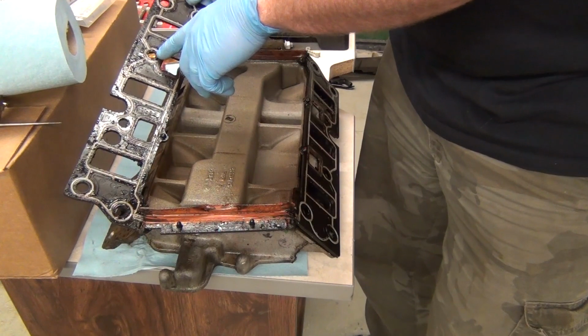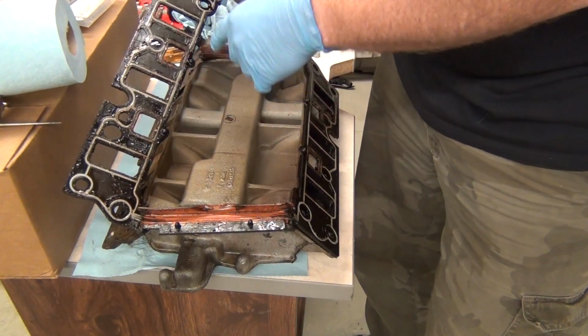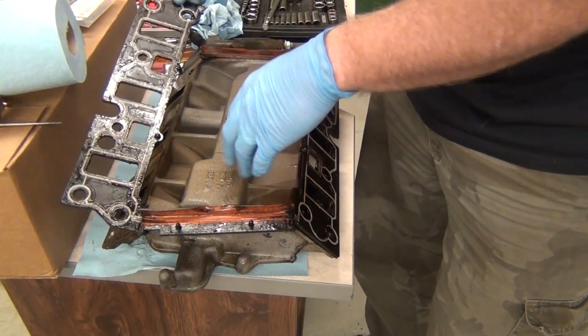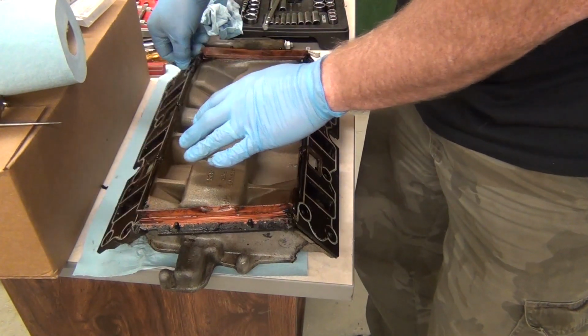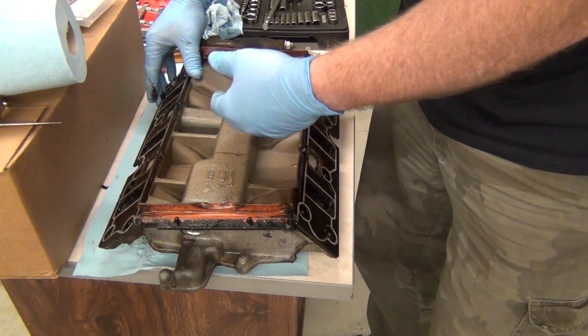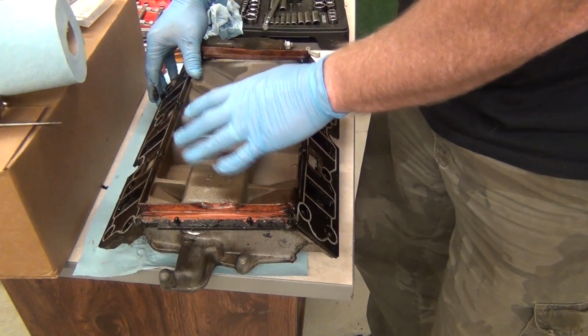These two are old, this is oil jacket. You see the oil that built up in there, and you get some that's going to be in oil, but these boats go through jackets. Some is water, and some are oil. The two cannot mix. You have to have them free flowing. If they start building up sludge, then you're not getting either enough coolant or enough oil to the engine. There's going to be failure somewhere.